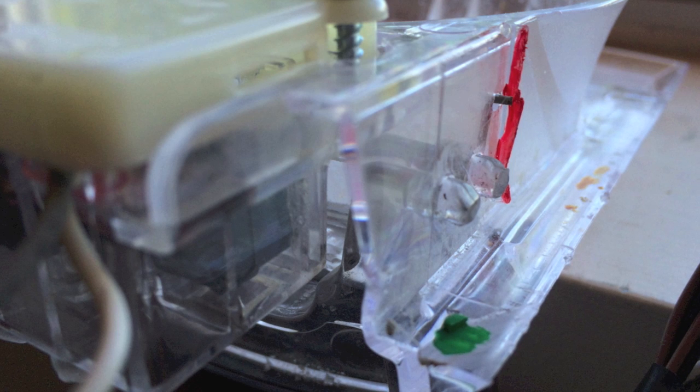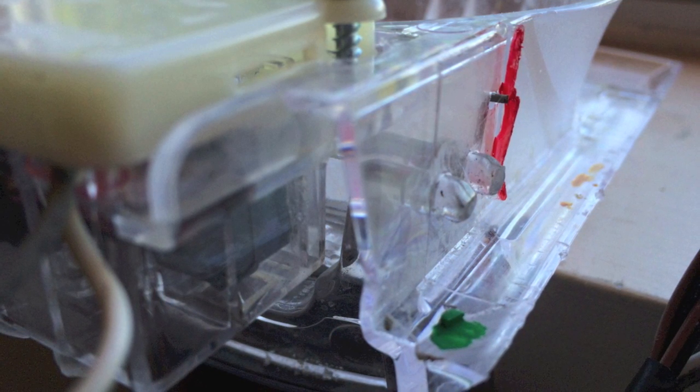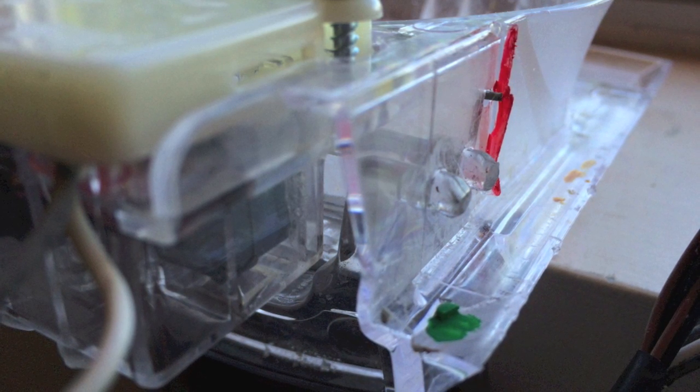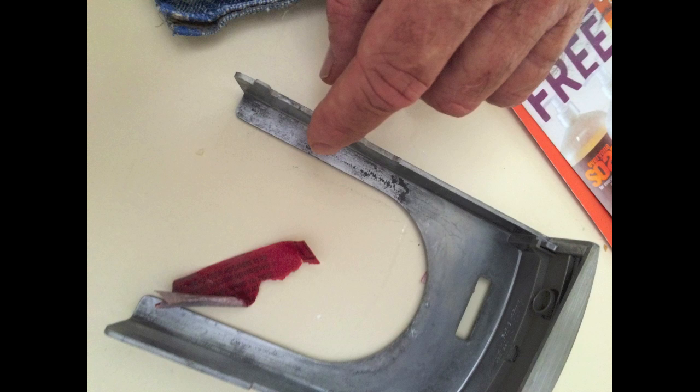This shows the nipples in green and the vertical pieces in red. These are colors I added. In the picture, the vertical tabs have already been removed. Now, the paddle assembly slid out easily. Sandpaper removed the corrosion on the metal piece. The metal piece shown was pressed back into place and the new paddle assembly slid in easily.